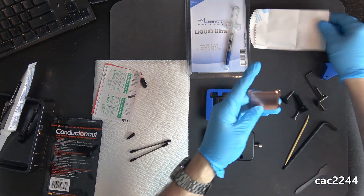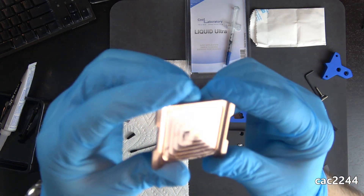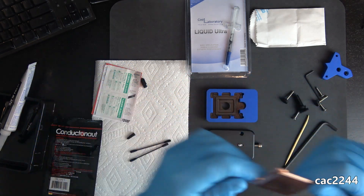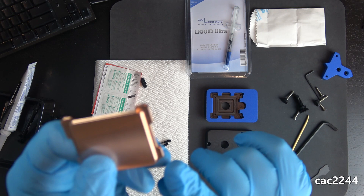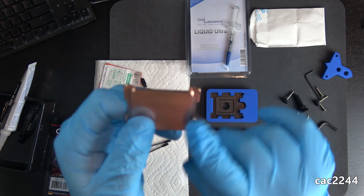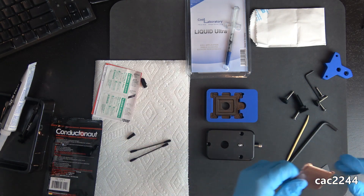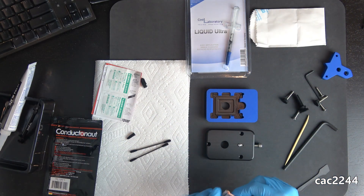To delid the chip, I used the Rocket 99 kit for LGA 2066, which also included a beefier replacement copper IHS — that's integrated heat spreader — which is the lid itself. By using a new beefier IHS, you're supposed to gain between 3 to 5 degrees Celsius, and it also removes the need to clean the silicon on the original Intel IHS.